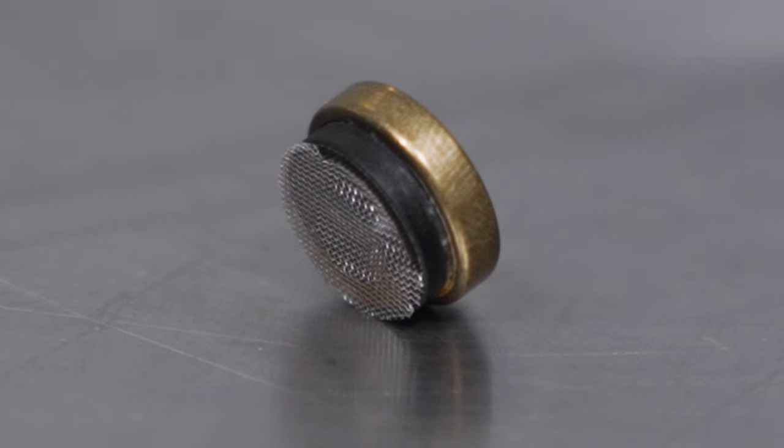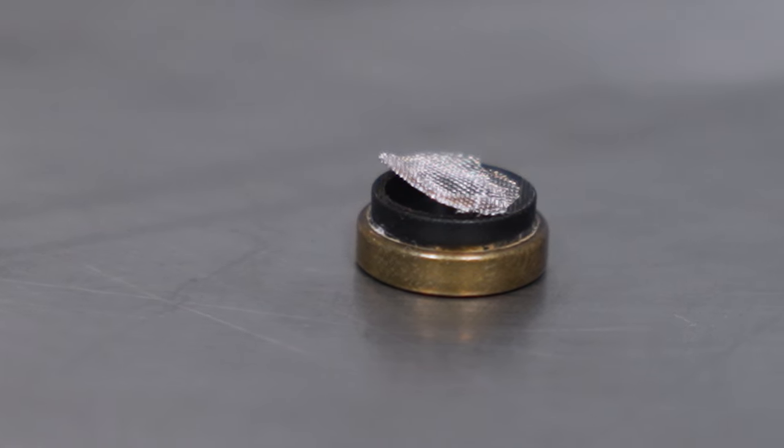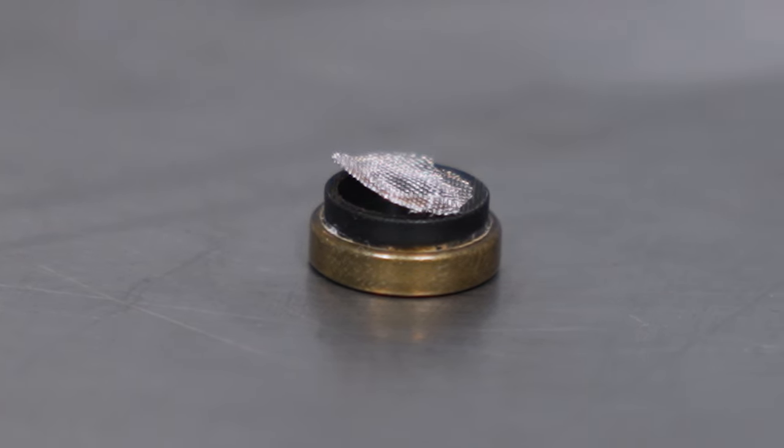It's made of steel mesh that has been over-molded with plastic. The weave of the mesh is restrictive, so normal oil pressure fluctuations can cause the screen to flutter. This fluttering tends to weaken the screen right at the area where the over-molding ends. The screen tears and dislodges and sometimes causes the exact problem it was designed to prevent.